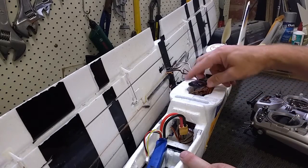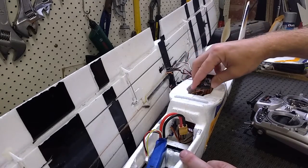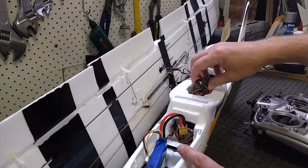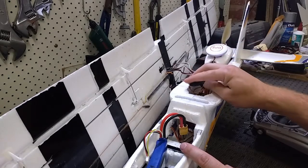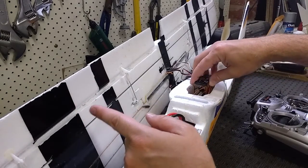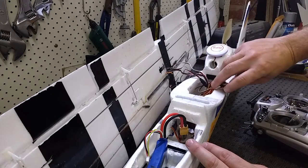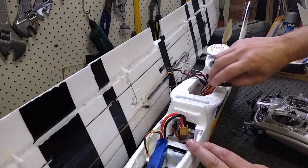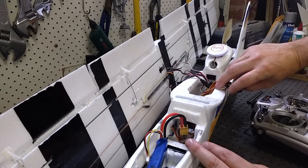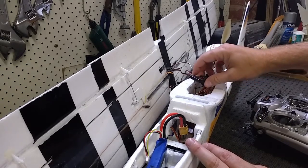The thing you'll notice is that there's no yaw control in stabilize mode, so if you rotate left and right, there shouldn't be any behavioral difference. But this is good because in return to home mode, you'll still get the ailerons compensating and the elevator compensating. What you will notice is that — imagine if the plane is flying off in the other direction — as you rotate and change directions of the plane, the surfaces will jump from one extreme to the other. Of course this is testing on the bench, so if you're heading off in this direction the aileron will turn it around, and if you're heading in the other direction it will try and turn back the other direction. So that's how I bench test.